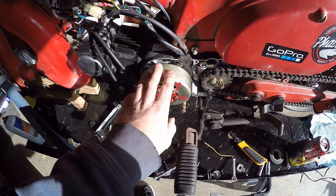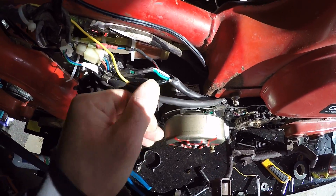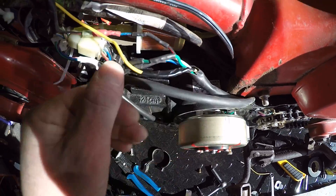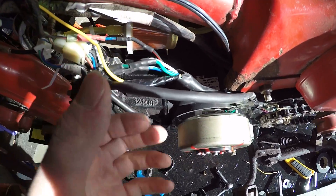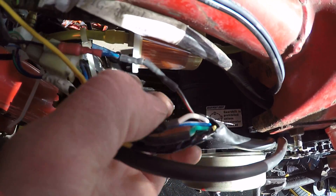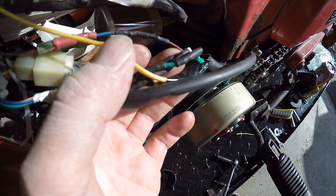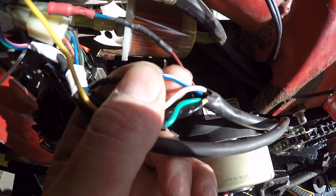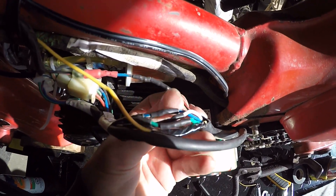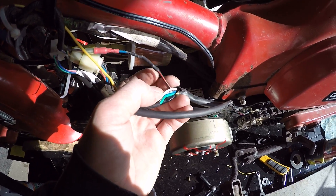The Chinese clone motor has five wires. It's got a yellow wire, which is part of the lighting coil system. It's got a white wire, which is another part of the lighting coil system. It's got a green wire, which is the ground. It's got a black wire with a red stripe. And last but not least, the blue wire with a white stripe. The black wire with the red stripe is part of the CDI's magneto system — that is what builds the voltage to set spark.